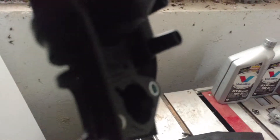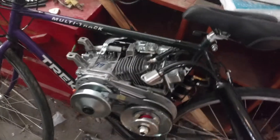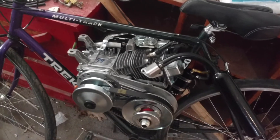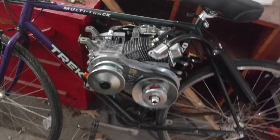The way it works on the factory air boxes is that there's this little barb — this little hose fitting right here — and it literally sucks the oil back into the engine and burns it up. It can actually cause some nasty backfires and reduce the life of your engine. So I'm half tempted with any other small engines I'd buy — be that a lawnmower, a Predator, or a Honda clone like this one — to actually get one of these Go Power Sports cold air kits. Redbeard's Garage goes into a lot of detail as to how much more power you can get out of an engine with that cold air kit.